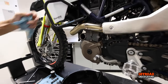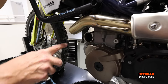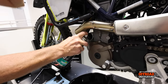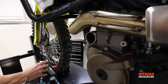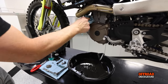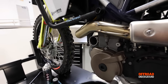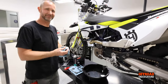I usually spray a little bit of contact cleaner into the filter cavity just to make sure there's no debris sitting in the bottom — liquefy whatever oil is left, then lean the bike over to get it out. Then I'll use a rag to wipe it out and make sure there's nothing in there. Not strictly necessary, but it's something I do.